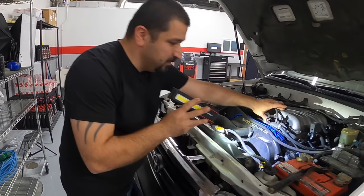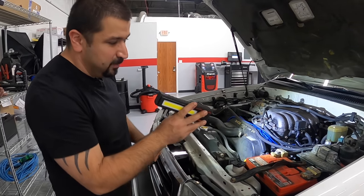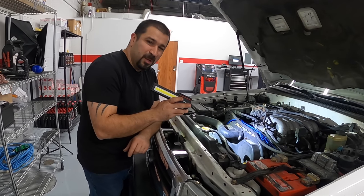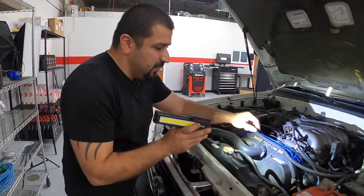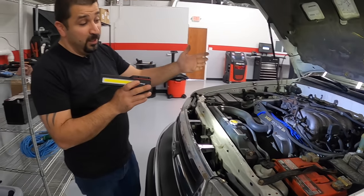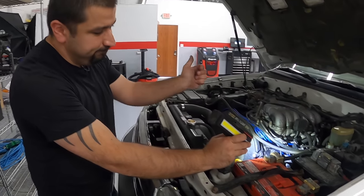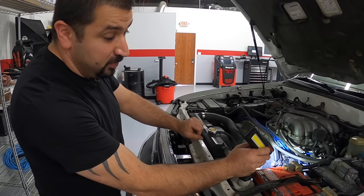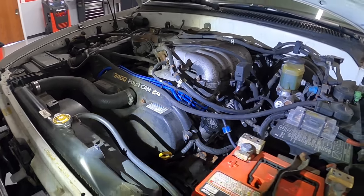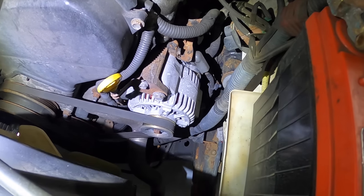Let's talk about some common problems here. First, this has a two-piece plenum — unlike other V6s where you just pull the plenum and you're done, this has two of them to access the spark plugs. You can squeeze the spark plugs out though, so you don't need to remove the plenum just for spark plugs and wires. Something interesting about Toyota spark plug wires: there's a manufacturing date on the original ones — that's one way to know if they've been replaced. One thing notorious on this engine is valve cover gaskets — notorious to leak. This one has been replaced but they didn't clean the residual oil. Valve covers are relatively simple; you do have to remove the plenum but otherwise it's super simple. This is a very DIY-friendly car. Something else super common: the alternator — this one has been replaced. They're kind of exposed to the elements and they go.